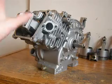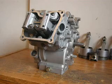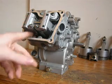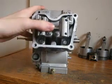First things first, I usually take the cylinder head off the engines first, but in order to take that cylinder head off, I got to remove the rocker arms and get the push rods out of the way so I can get to the two bolts that are down in there — there are four altogether holding it on.